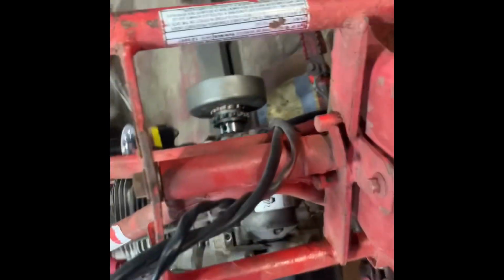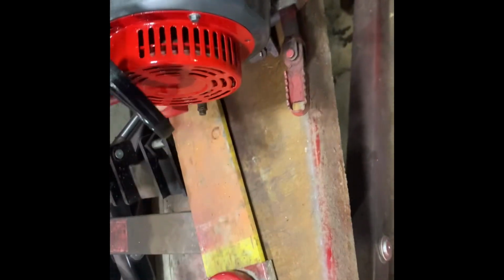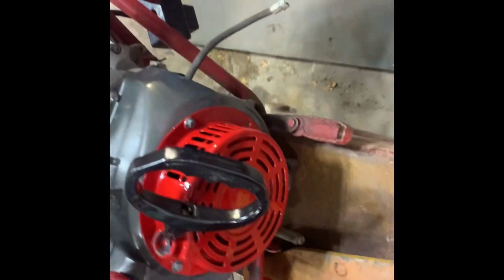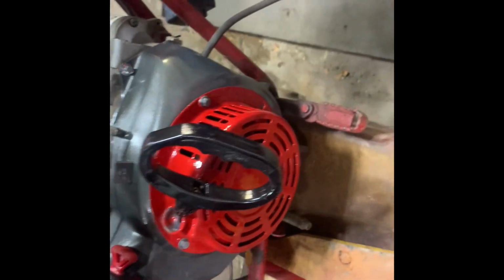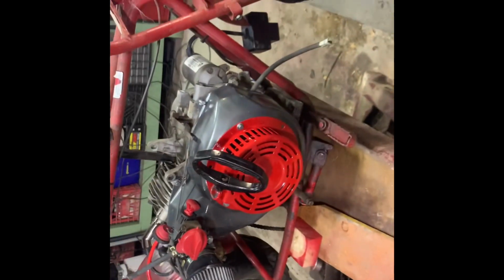So, yeah, it doesn't look too bad at all. You can see from the front how much it sticks out the side. Overall though, the cylinder head is almost centered in the frame, so it's not terrible. I'll have to do something with the foot peg, obviously move it or extend it. This is going to be doable. I'll take the engine back out for now and figure out what I'm going to do for risers to make it an inch higher or so, maybe an inch and a half, because I've got lots of clearance up here, tons of room up there. So I'll see what I can do about that.